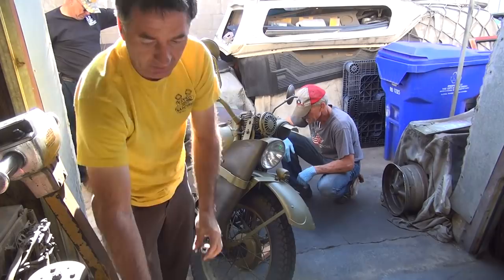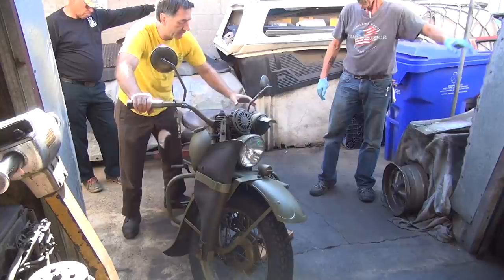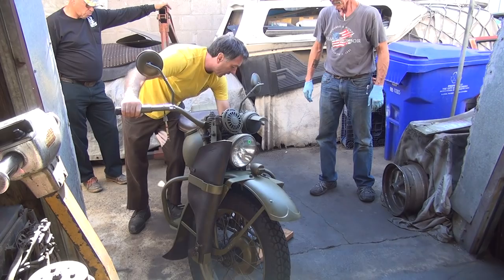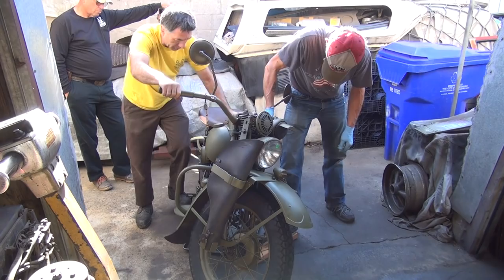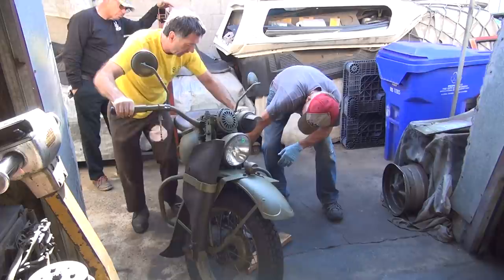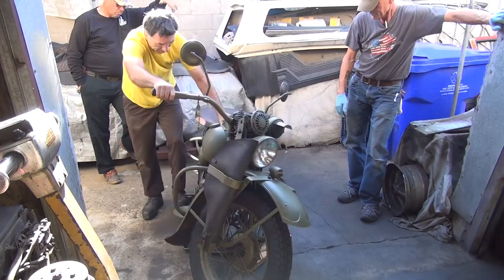Okay, let's get some fuel in the motor. Pouring fuel out of it. Okay, put your hand completely over the end of that carburetor. Plug it up all the way, 100%. Sucking. Okay, how much fuel came out? Is it pouring out? It is now. There you go. Now it's leaking. Now we got a little bit of choke right now. That's coming out. Yeah, you got it.